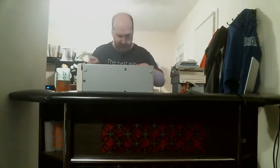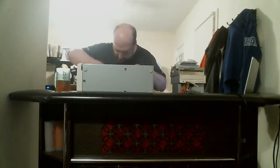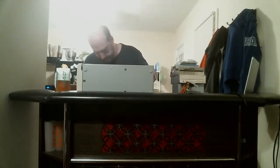This case did come with this speaker. I don't know where this speaker is supposed to mount in this case. It was a little bit crushed and just floating around the box. And I didn't see a spot where there's any clips or anything to hold it. The easiest would just be to let the magnet of the speaker hold it to the bottom of the case, and you just hear a beep coming from inside the case. So we will do that for now. So let's see, that's going to be JP18, which is next to JP15. And that actually is 4 pins for this 4-pin connector. So that one's not confusing.